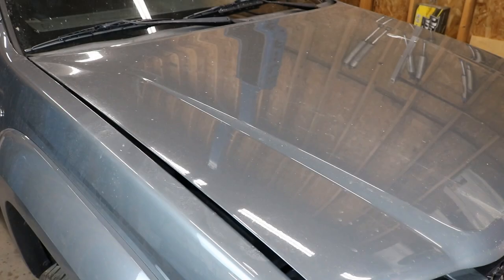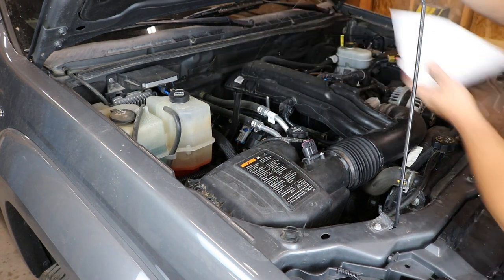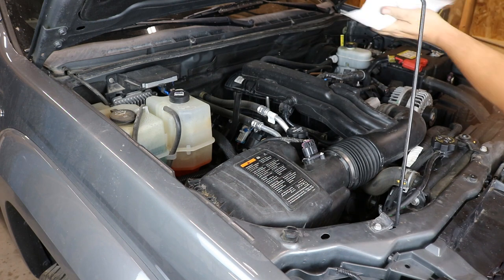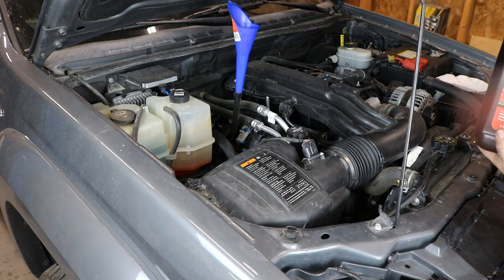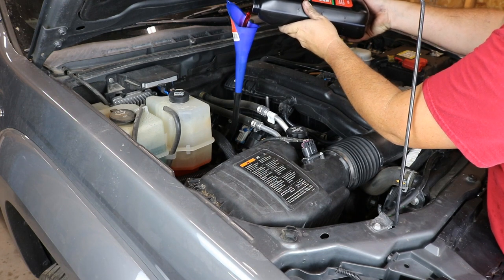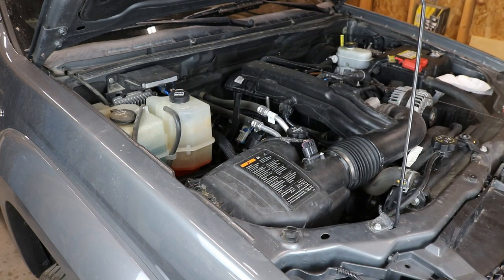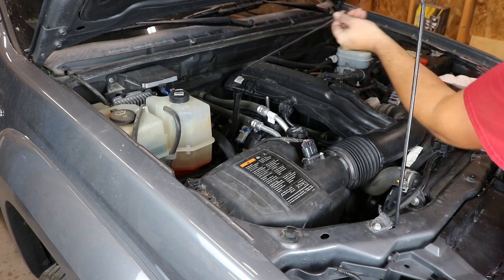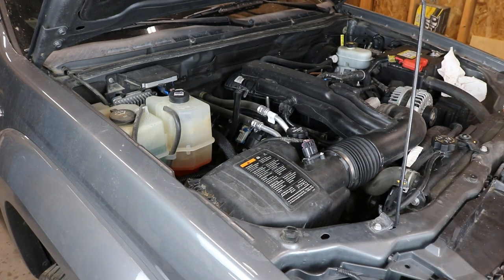The final thing to do is open the hood, pull the dipstick out, and add fluid back in. With the truck off, put a bunch of fluid in to fill up the pan, then start the truck and cycle through the gears — reverse, first, second, third, fourth — then put it back in park and check the fluid again while it's running to get the air out of the system. You're supposed to check fluid at operating temperature, so let it idle a bit, but don't let it idle with low fluid because temps will skyrocket and you could damage the transmission.